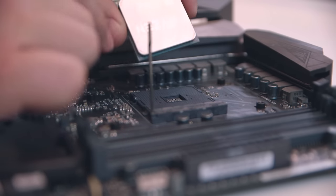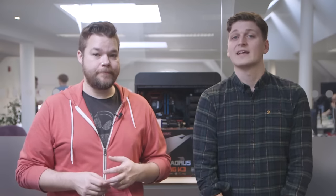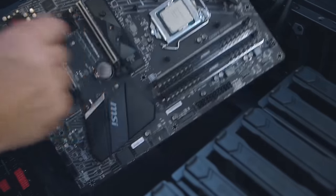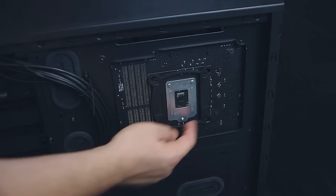On an Intel CPU there will be notches inside the CPU which line up with the parts of the socket. For AMD there will be corresponding arrows in the corner of the socket and on the corner of the chip. Get everything lined up and gently seat the CPU — you don't need a lot of pressure, so if you feel like you're forcing the issue you might have it aligned wrong. It's worth getting the RAM installed before the motherboard goes in the chassis too. Before you install the board, check to see if your cooler's mounting bracket should be installed first, as many modern chassis have big cutouts in the motherboard tray, but older case designs may require the bracket fitted before the motherboard is screwed down. These little checks can save you from the pain of having to unscrew the board again.